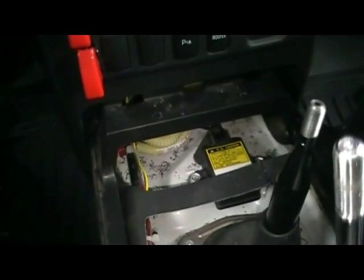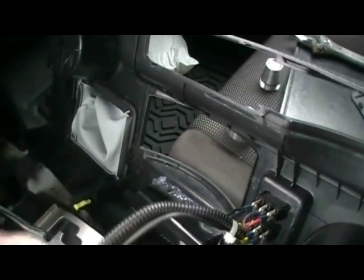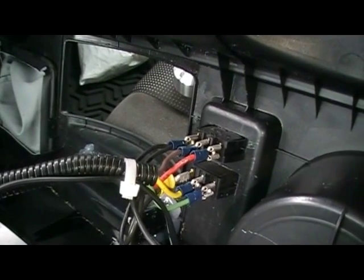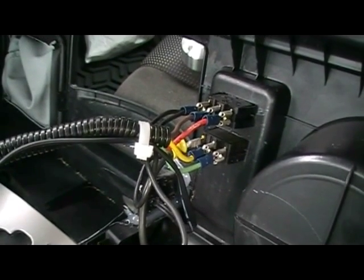What I've done is taken my wire, tied it into an existing factory wire, run it up with plenty of wire length, shielded it, with the outer wire being a ground wire grounded to a body mount - I tested it as a good ground before doing this. I've wired the switches so the backup light can only come on if the vehicle is in reverse or if the park lights are on, so I can't accidentally leave the backup light on when walking away from the vehicle.